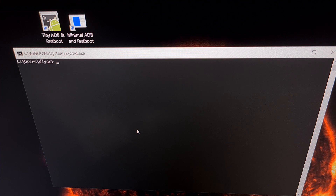From here we can reboot out of recovery mode with a broken power button by simply typing the command `adb reboot` and pressing Enter. We're immediately going to see our phone restart and we should not get any error messages.